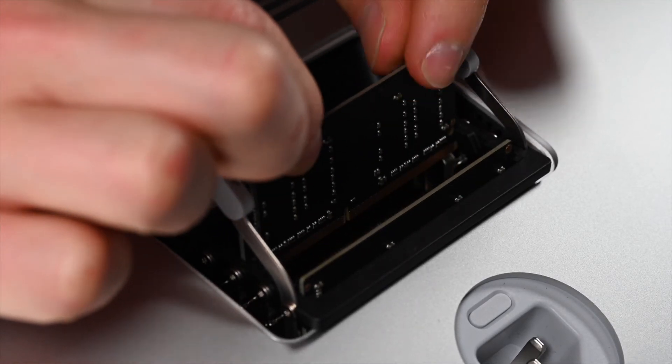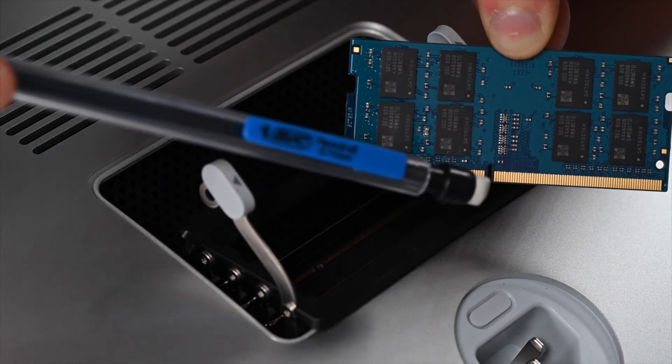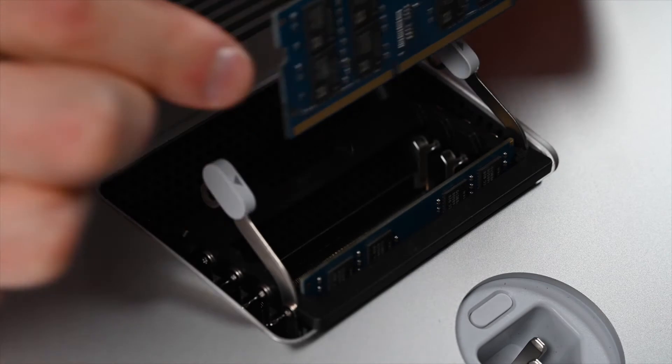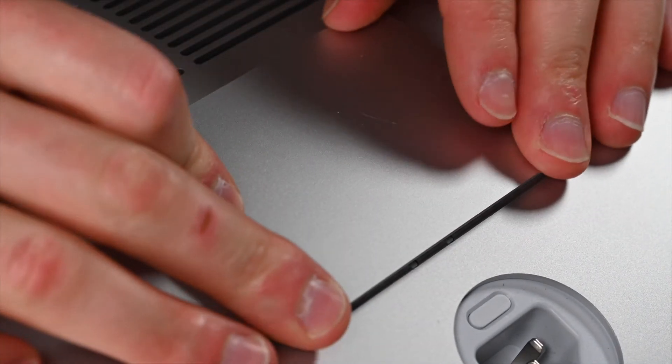Once you've decided on your configuration, pull out the base sticks with two hands — sometimes they need a little bit of force. Take note of where the notch is on the RAM; to line it up properly, you want the notch to be on the left side. When I did this earlier while shooting the stop-motion clip, I was distracted and mixed up the orientation, pushing on the RAM more aggressively than I should have and not understanding why it wouldn't seat. They might need a little force, but you should be able to tell pretty quickly if you have it backwards. Once the RAM is in, push the tabs inwards and the whole cage back inside. Line the RAM door up and push that back in as well — it does take some force and sounds a little scratchy.